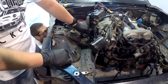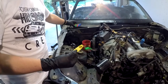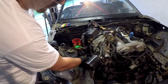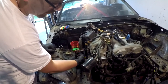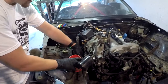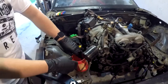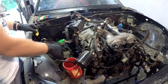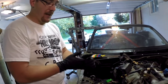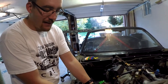These fuel lines can be a pain in the butt if you don't have the correct tools. Fortunately, we do. These fuel line disconnect tools come in a split set — you wrap it around the line and push it in underneath to get a hold of the plastic tabs. Have something handy to catch some gas just in case. So there we've got our gas line completely disconnected from the main line coming back from the fuel tank. We're catching what's left coming out of the fuel rail in this can.